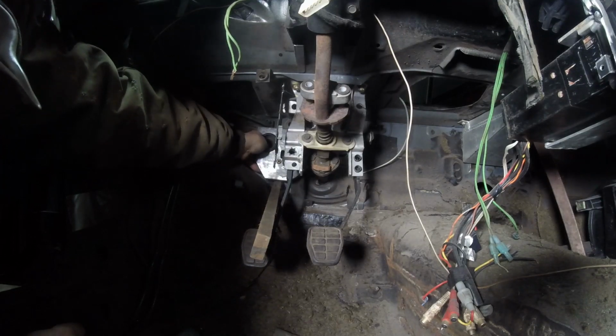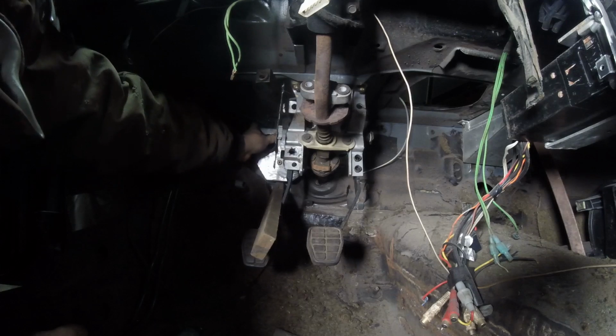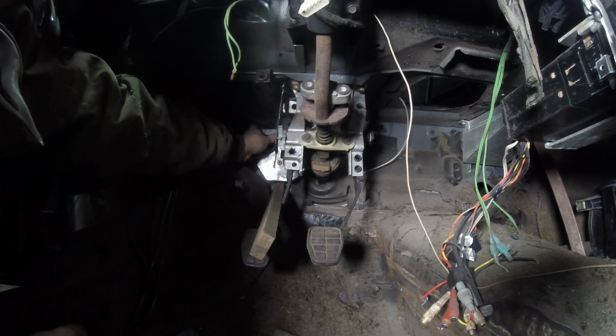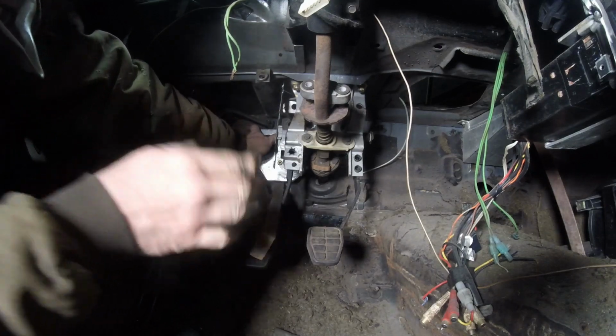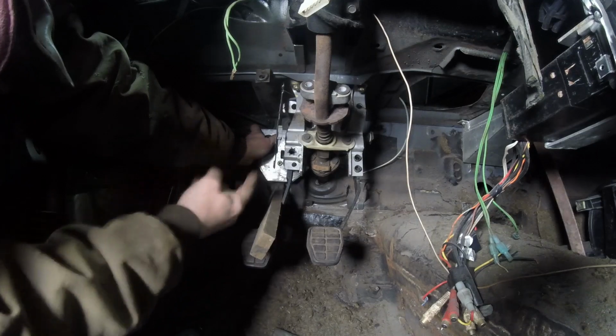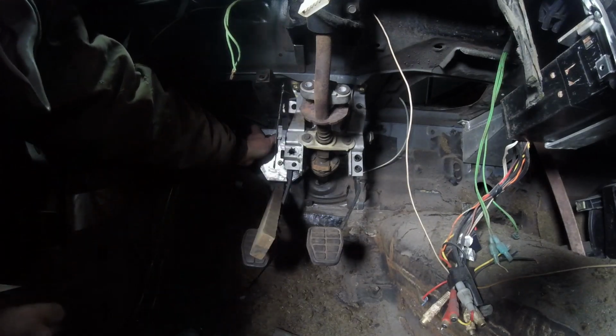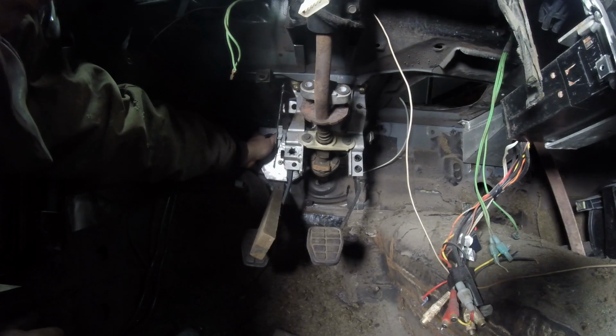That's pretty much where it's going to go. It's being blocked by the camera because you can't see it, but the master cylinder looks really close to being right on equal. It's a little bit up because when you push the pedal down, it's going to rotate the piston up and down. So you need a little bit like that. I'm going to put it at a little bit of an angle, but let me pull it back out again and clean up the rest of this.